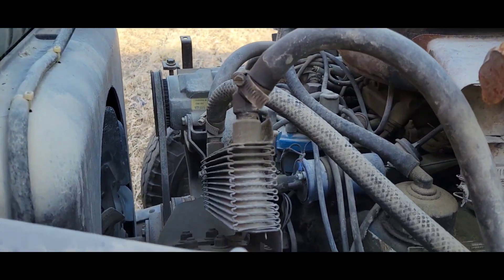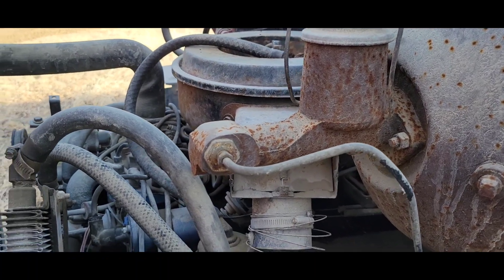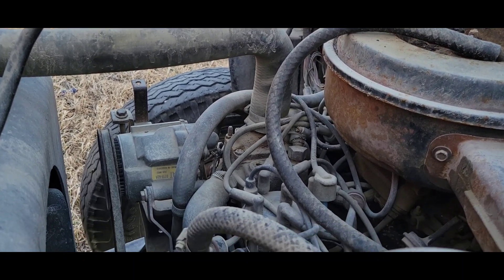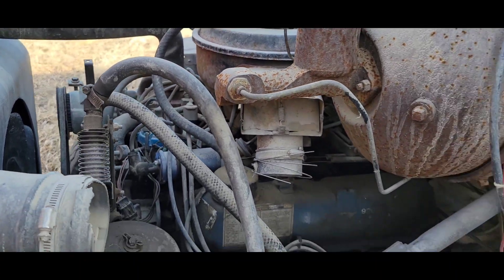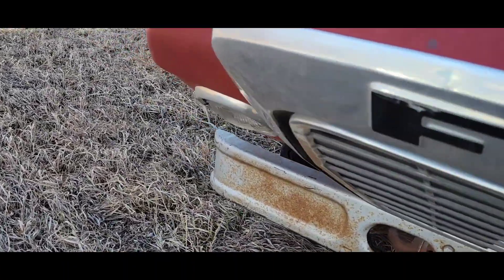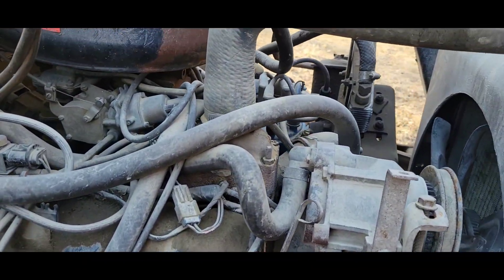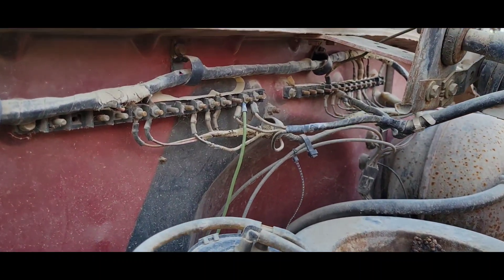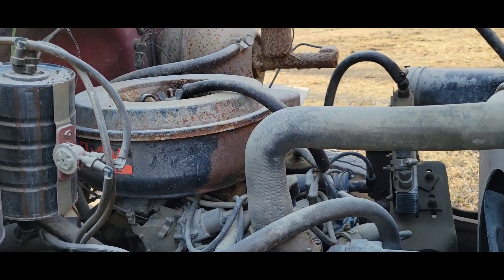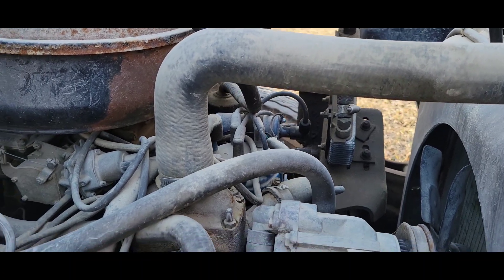There she is. He said it was driving just fine and then it kind of cut out like it lost ignition. So I've got one of those HEI distributors — I'm going to pull the distributor out real quick, swap in the new one, find a 12-volt source up there on the wall, run a wire down to the distributor, and I should definitely have spark.